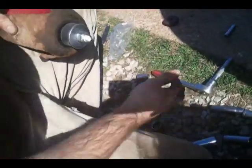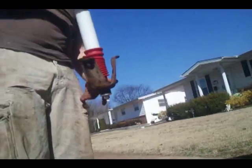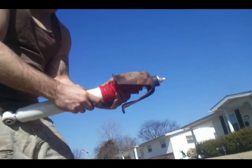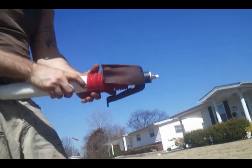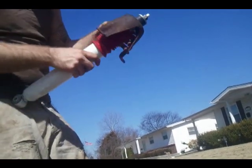You want to tighten these up good, but you don't want to tighten them all the way. There's a spot on this thing. Yeah, see, I'm as good as I'm going to go now. I'm going to get a 3/4 open end wrench to hold that nut. Alright, I got it on there. It's tightened pretty good, but I didn't torque it yet. The boot moved around a little. It's not a big deal. It's going to move around once it's on there to where it wants to be.